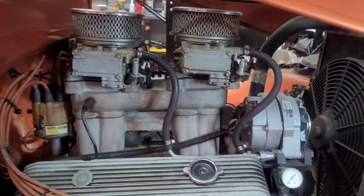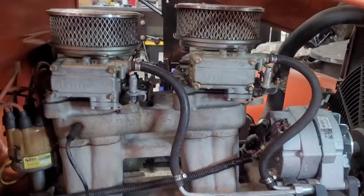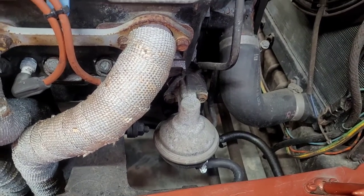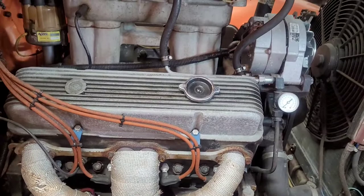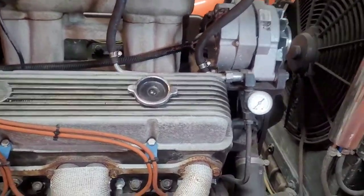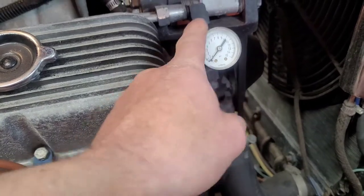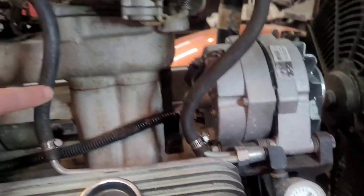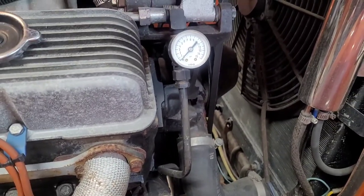This is what we have currently. It's got two Holley 450 or 490 CFM - I have to look up the number - sitting on top of what I think is an Edelbrock intake. It's an old Edelbrock. OEM-style stock fuel pump, nothing snazzy. This engine isn't anything real fancy - it's got flat tops, a mild cam, iron heads that just had a good valve job. It doesn't have maybe more than 9,000 miles on it, but the engine is 20 years old. I want to replace that steel line and fittings - we've got a flare fitting and some adapters with the tee - and replace it with all hard line, tube nuts and sleeves, stainless steel.